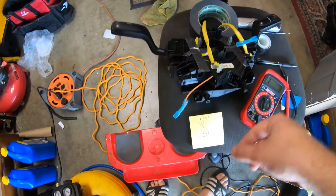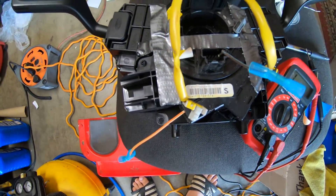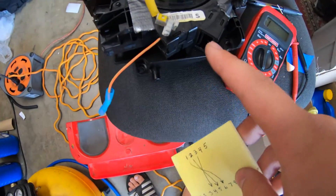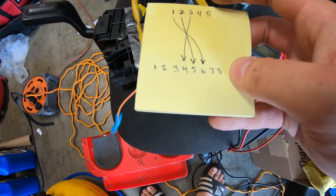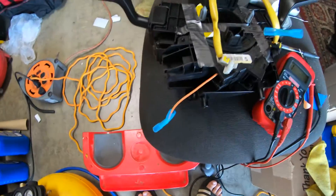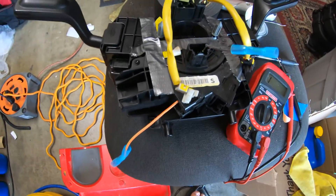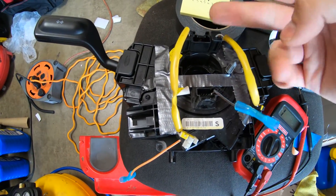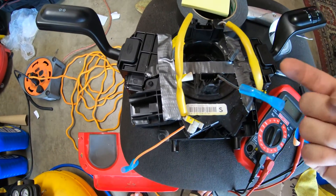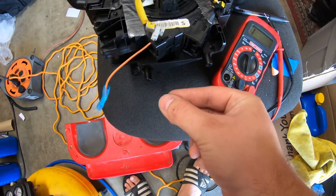Made a little bit of a discovery. I mapped out the ones that have the existing harness. So pin one goes to seven on this one, two to five, and three to four. This one is completely unused — it actually had a cap on it and nothing plugs in here. Mapping these out, this actually goes to here. So I do have a couple of options: I can use this one which has an existing harness — I would just need to cut the line and then splice the paddle shifter lines into it, and then cut the line down here and splice it going to the computer.